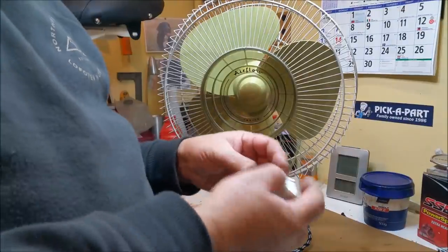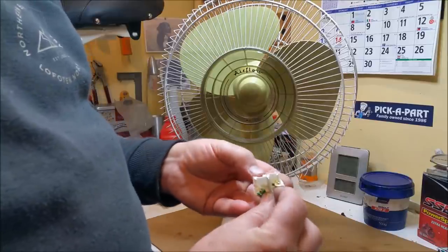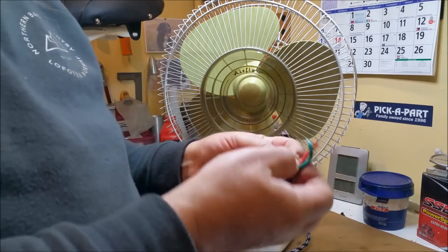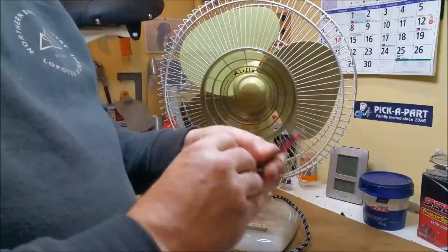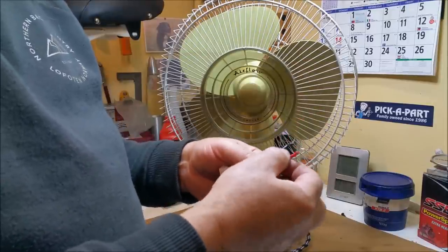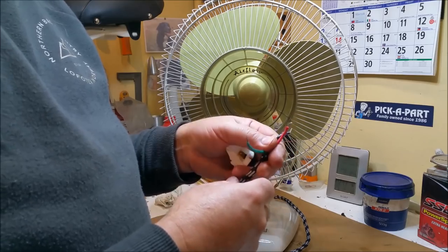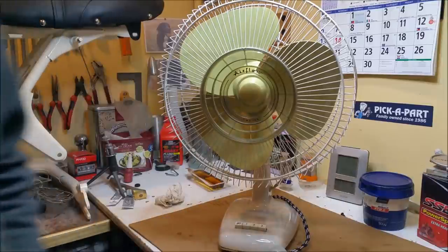So the other thing is modern plugs are all marked. The earth, of course, is green. The neutral's got an N there. The A is active. Very interesting. Very easy on these. Black's neutral. Red's active. The newer ones are blue and brown, for neutral and active. I always think of active as brown, because if you go near touching it, you're going to crap yourself, and poo is brown. So anyway, I'm going to put this on, and we'll give it a road test.